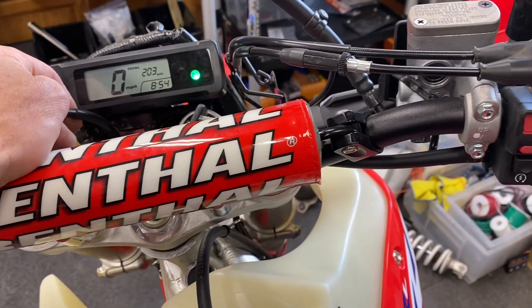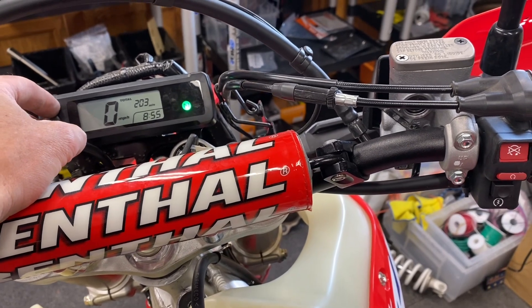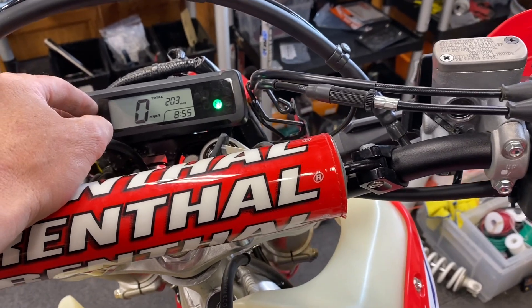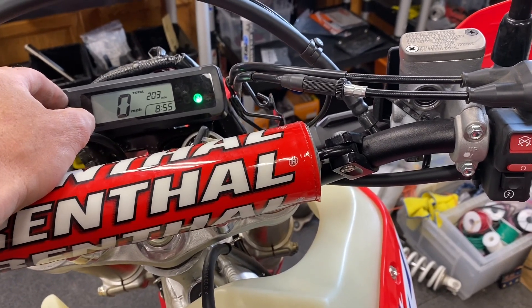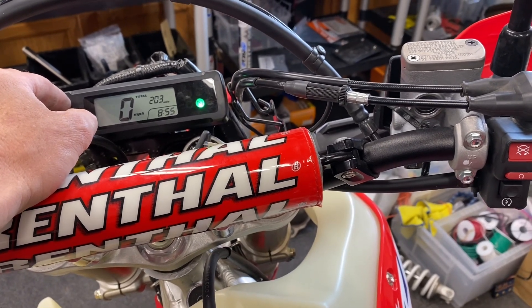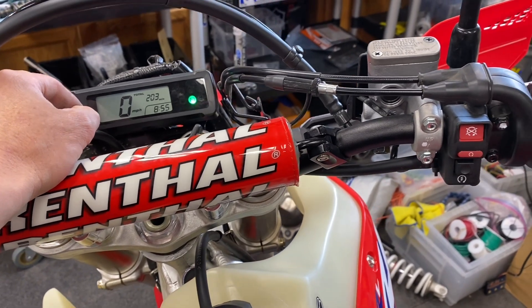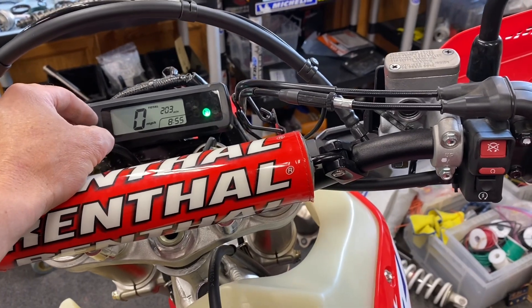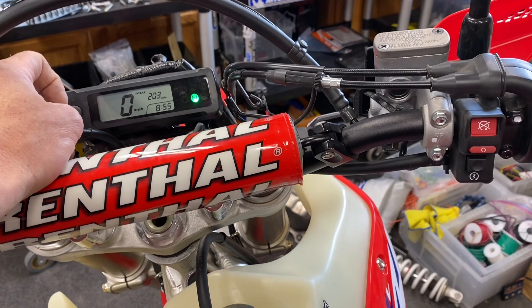Those two features are how you set up the TPS endpoints on your Vortex. Who would want to do this? Anybody who has a bike where they suspect the previous owner had messed around with the TPS at all — there are internet forums and YouTube videos that talk about screwing with the TPS for different performance levels. If you suspect anybody's done that, you're going to want to set the TPS. We also like to do this on every new installation, because even though the stock bike is supposed to have correct values and the Vortex is supposed to be pre-programmed to accommodate that, there are instances where you'd like to verify it. We always do this operation when we install a Vortex ECU. If you have any questions about this procedure, or anything related to your bike, tuning, or anything we can help you with, please let us know in the comments, and go out and get some adventure.